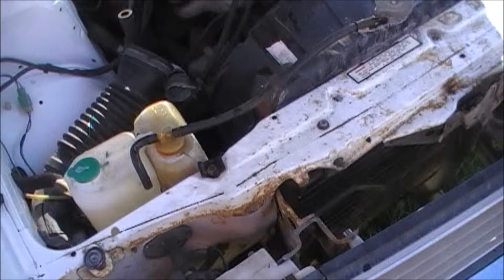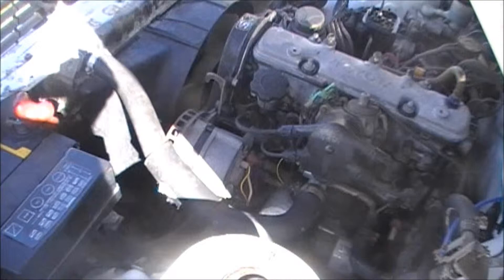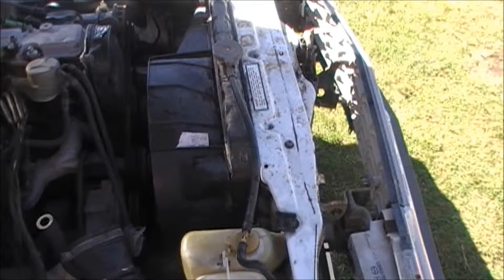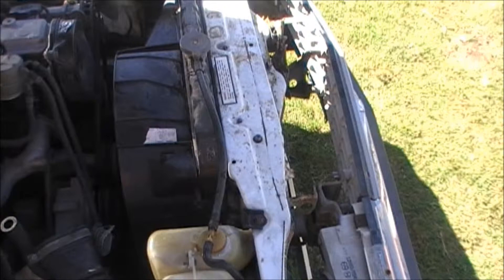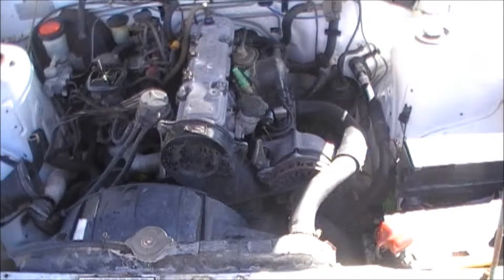It was overheating. I noticed it does not have a thermostat in it, or the thermostat had been gutted. I'll flatten that out a bit to give it more restriction and put it back in — frankly I'm not spending $43 on a new thermostat just to test it. Radiator was severely blocked. I soaked it, filled it up with vinegar and left it for a couple of days, flushed it out, still not happy with it, so I put some radiator flush through it. It doesn't seem to be running hot, but I've got a leak where I took the thermostat out and I don't want to pull it apart and re-silastic it up at the moment.